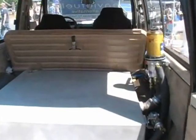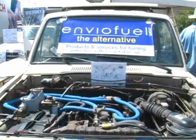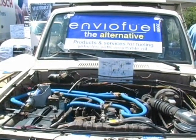So what we do is put in a second heated fuel system. You select that fuel system after your vehicle's been warmed up on either biodiesel or straight diesel. So after firing up the engine, you wait till your engine reaches normal operating temperature, and then you can flip that switch, and you're pretty much driving for free for as long as you can stay awake. When you get close to where you're going, you want to switch back to diesel so you have an easy startup.